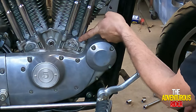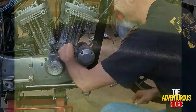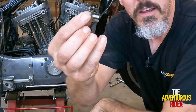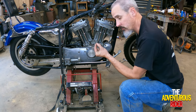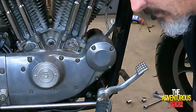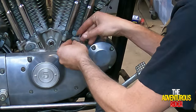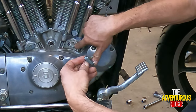You can see right here where there's a little groove — hopefully you can get in there with your fingernail to pull one out at a time. That's what it looks like. I'm going to replace this little o-ring right here on the very end. Now that the o-ring is replaced, I'm going to put it back in and do the same thing for the other one. Once you've got the o-rings replaced, you can put your plate back on, making sure that the little groove is lined up with the pins.